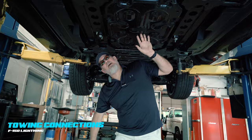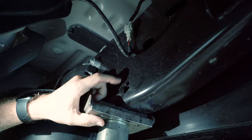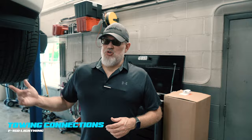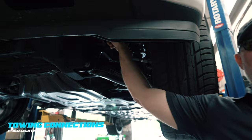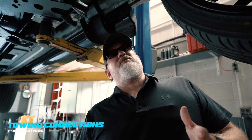Over here on the driver's side you can see we still have a frame rail with the battery inside it. Right here there's an arrow — this is one of the jacking locations. On each corner there's an arrow stamped in the frame, and wherever that arrow is stamped is a lifting or jacking location. We're not putting jacks underneath the rear end or front suspension — those four stamped arrows on the frame are the only four places you can jack the vehicle. Up here on the front driver's side, there are some slots in the front of the rails that people have been connecting to, but I've been seeing damage claims come through. Ford has identified slots farther back in the frame rail, right behind the front sway bar — those give a better departure angle for your bridle and won't damage the valance.